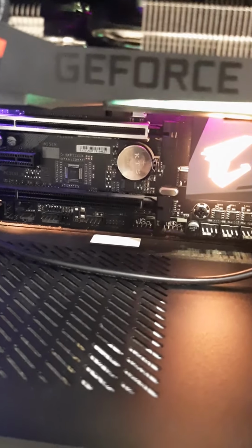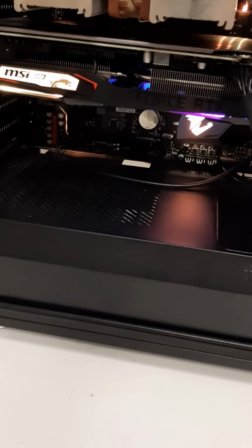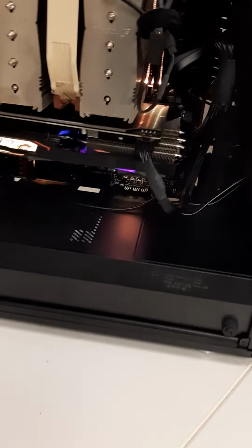So you take that out, obviously, for like 15 seconds or whatever, reset it, and then you take out the GPU, then you move the HDMI to the motherboard. And then you turn it back on, and you should be back in business. And then obviously, turn it back off again, put the GPU back on, and then boom, you're good to go.